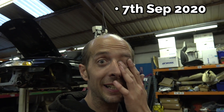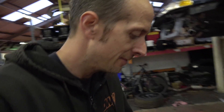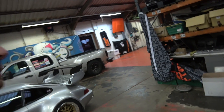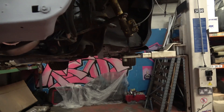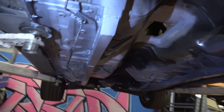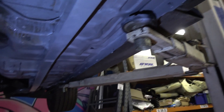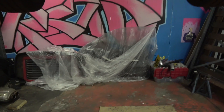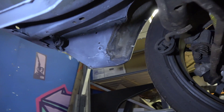Let's have a little Monday night update on the Mustang. It's getting quite late now, getting dark outside and I'm pretty hungry, but let me show you what I've been up to for the last week or so since I finished the tunnel. Brushed off the front of the car and that's had a couple of coats of POR-15 now and has been primed since. Anywhere where it was exposed metal or starting to show its age has been brushed off and is now POR-15 and primed. That's the coating I've chosen for the floor — I've used it before and it worked. Edges and stuff like that are now ready for a coat of bed liner over the top.